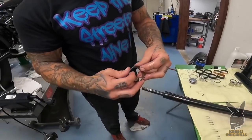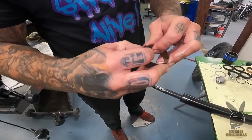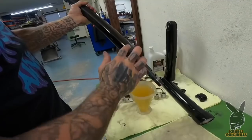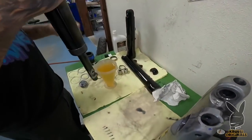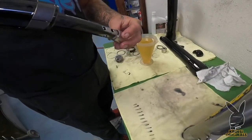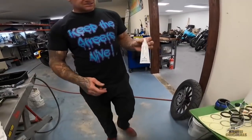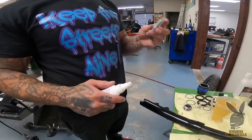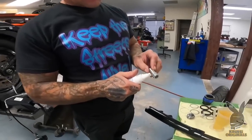This bushing — I want to take this and kind of bend it in just a little bit, just give it a little tightness, because they tend to be a little loose and they want to pop out when you slide them on. So just nice and tight — rub some lube on it. Remember I put lube inside the tube as well with my finger — fork oil is what I mean by lube. This is Permatex thread sealer — it's like plumber's dope, pipe dope. It does not go up here on the threads; this is not to Loctite this bitch into the dampener rod. If you do that and you try to get it out next time, the dampener rod is just going to spin in there and you're going to have to cut your fork tubes in half to get it out. This goes down around the bottom — this is to seal this cheap-ass crush washer that they put in these things.